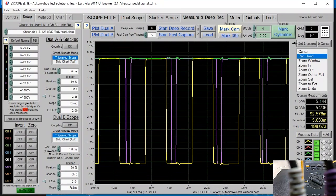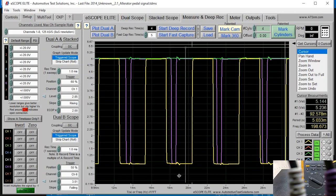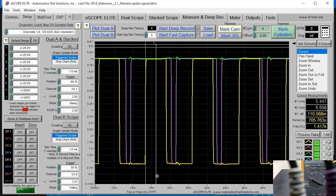I'm going to measure the cycle of the signal - the frequency. Using cursors on the first trace, this signal design for number one starts its cycle on the rising edge, and you go back to the beginning of the next cycle at the rising edge - that's one complete cycle. Looking at the frequency measurement at the bottom, we're at 200 hertz.